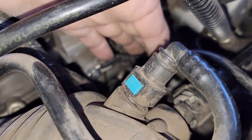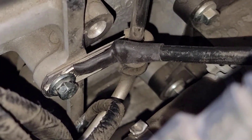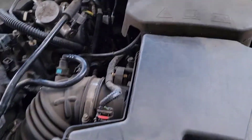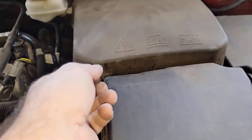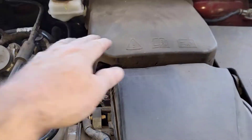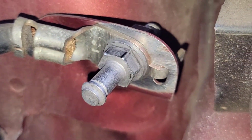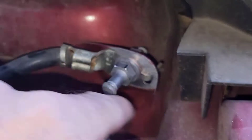Got that cable right here. I just had some connectors I already had here — I just had to smash them on, then put on the heat shrink tube. I just have that going over here back to the negative. This is all cleaned up. Let's see if I have any dielectric or anything to put over that. But this is Arizona — it doesn't really rust like it would in some areas.